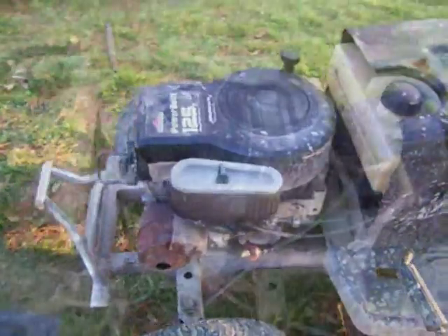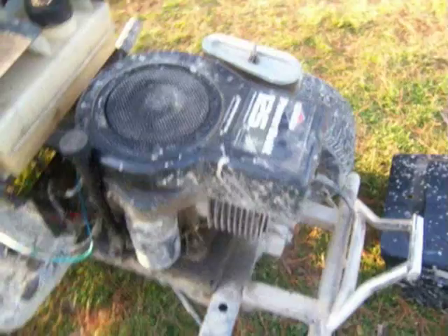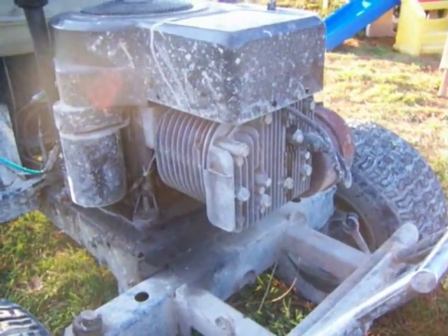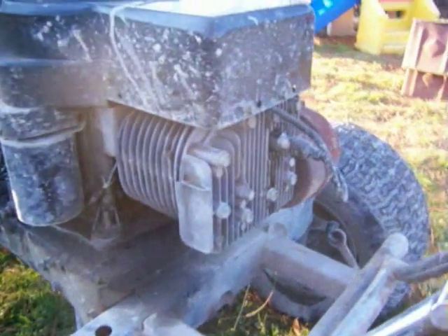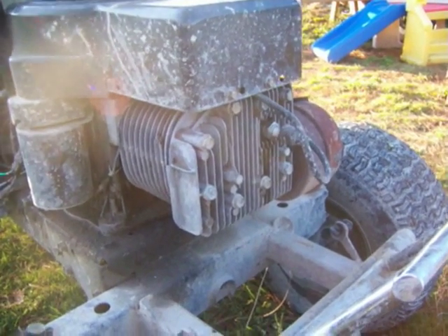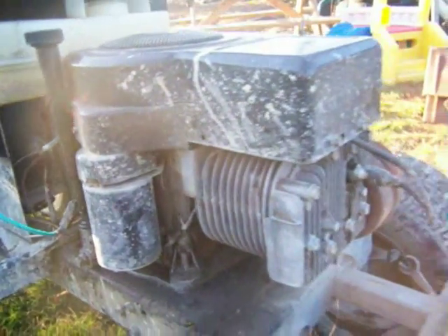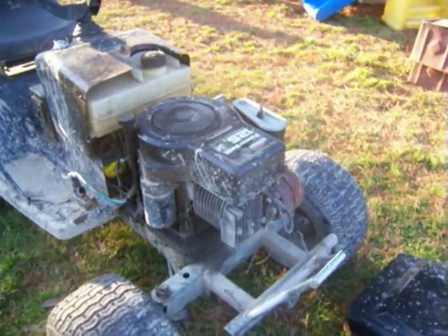This is the engine — a 28 cubic inch Briggs & Stratton flathead. I rebuilt it at the beginning of this summer. It has an industrial commercial block with a cast iron sleeve. I ported the head and the eyebrows on the engine side where the flathead sits. The connecting rod is from an OHV motor, which is said to be a bit stronger.